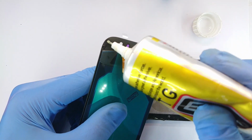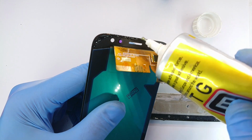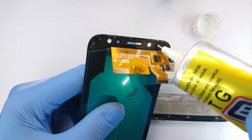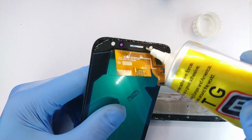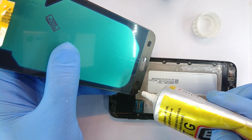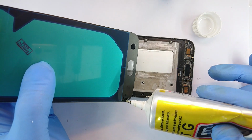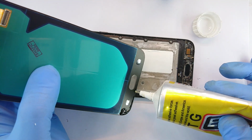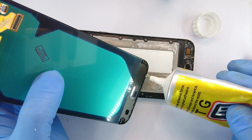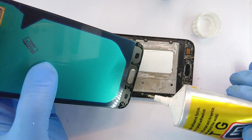We are also going to apply for good measure, because the adhesive adheres best when still molten, but then coheres also well in as much as it has already roughly hardened. Yeah, that's the reason I put on both surfaces, to make sure the bond is great. Notice that I'm beginning with the much wider surfaces, but then you should also be referencing it to the place it's going to make contact. Remember, we are preventing adhesive touching here, so while putting on this surface, keep in mind the frame of the phone and the areas along it for adhesive to bond. Okay, so since this is just for good measure, like to be thorough, I may not over put excess.